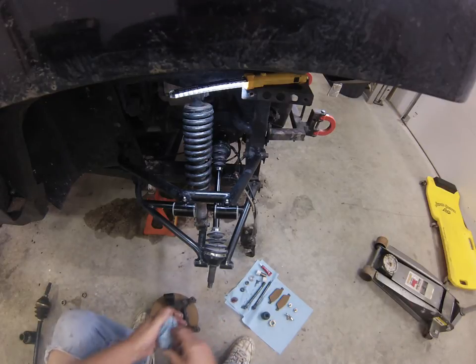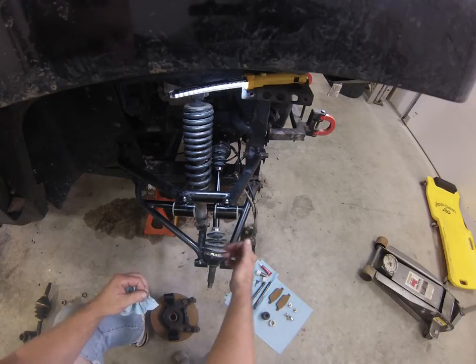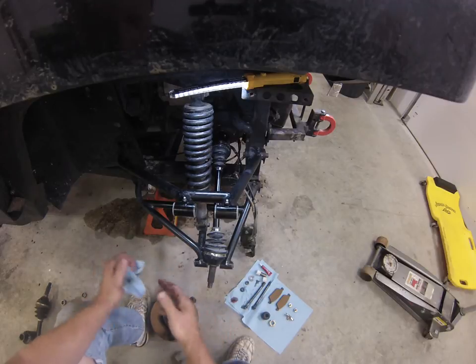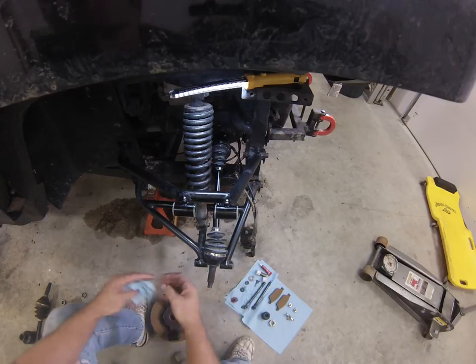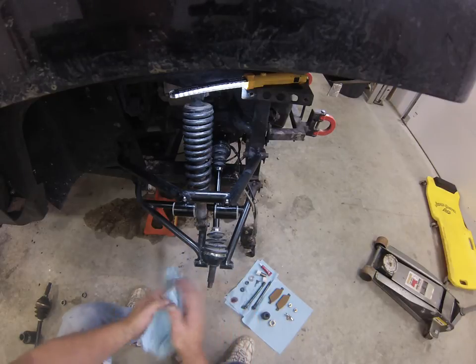As far as to diagnose, what I do is if I can reach in the back and shake my caliper, when it's just sitting in a neutral state, I can see if those are moving. If I can't, then I know they've probably locked up and I need to clean those. You'll find, depending on how you're doing it, you'll need to clean those caliper slides a couple times a year.